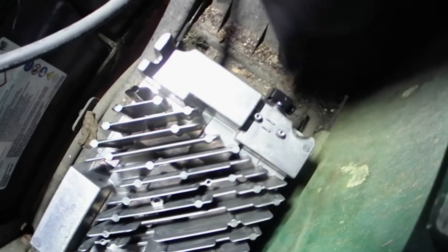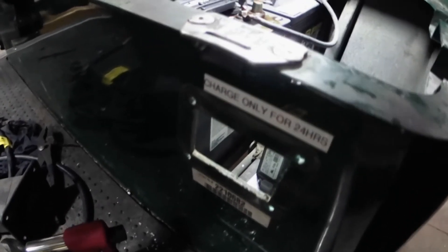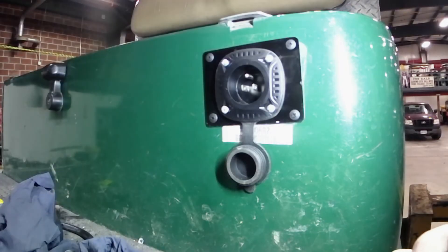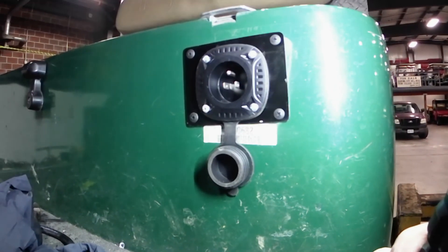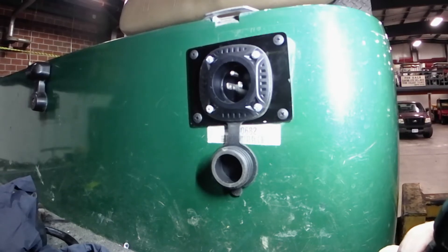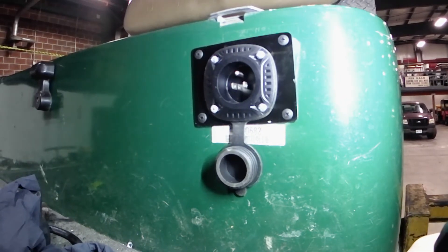Next thing is just at this end we need to plug the power cord into it, and this thing is ready to go. But I'm going to put an outlet on the outside of the cart — a plug-in so you can just use an extension cord — and I'm going to wire that in. Here's what I used for an outlet on these carts: just a flat panel mount plug. You can plug an extension cord right into it, it's got a little pigtail on it. I take out the factory charging port, make a little plate, pop a hole in it, screw it in place, and we're good to go. It's got a nice little rubber cap to cover it up when you're not charging.